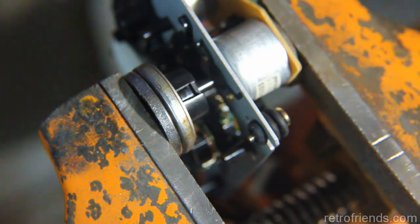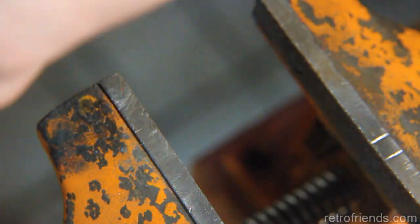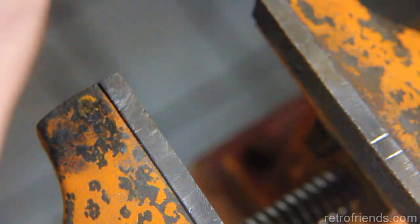There, see? And then it only goes a few millimeters, which is fortunate. So each time when I'm done, I go and look back to see if we're doing well on our spindle depth. And that is really close. We have a danger of not pushing this down far enough, and then the laser not working because the disc isn't close enough to the laser. But that is so close. I think that's right on the money, actually. So we're going to give this a try with our game and see if it'll read discs better.